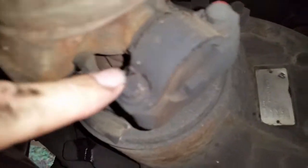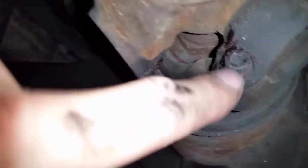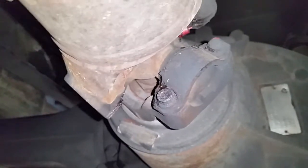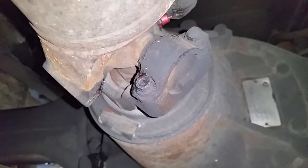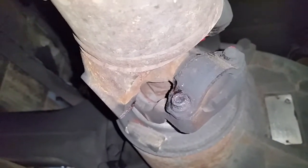While I'm under here, I thought of something — just to put in your arsenal of tools. This is a 12-point socket — I forget the exact size. If your RV ever breaks down and has to be towed, you want to make sure you have a wrench or socket that fits this so you can undo your driveshaft and tow it, because you never know if the wrecker is going to have all the tools needed. Hopefully that day never comes. They may also recommend pulling the axles — that's another option — but most of the time they just pull the driveshaft. Something to think about. Anyway, I guess this job is done — I'll clean up my tools and get on to the next project.